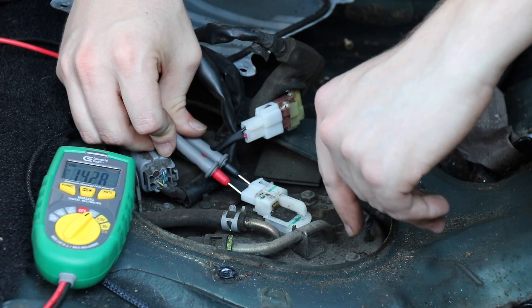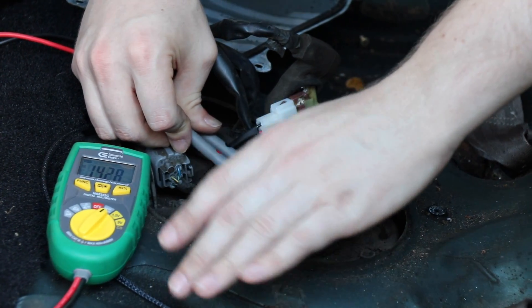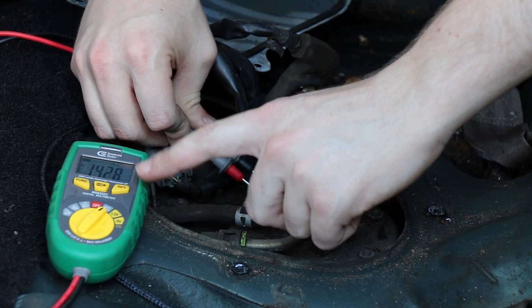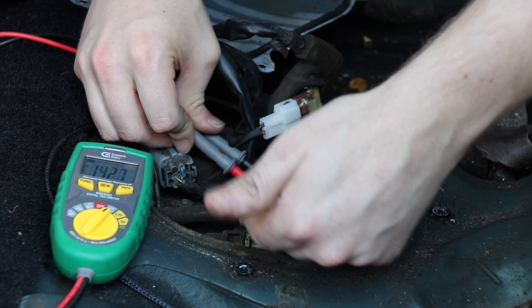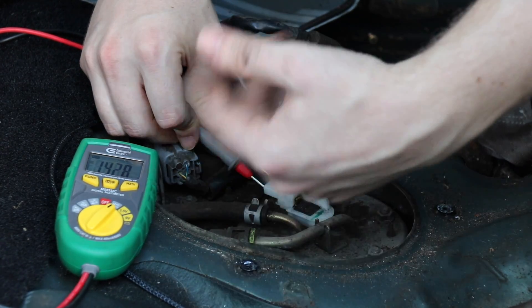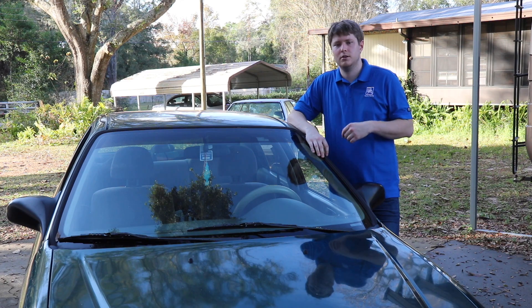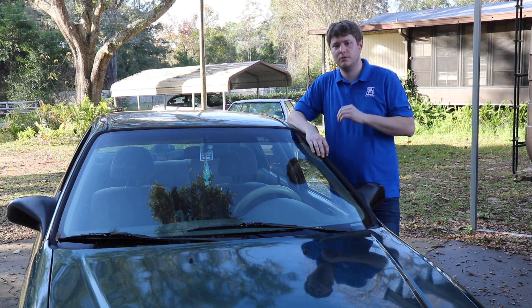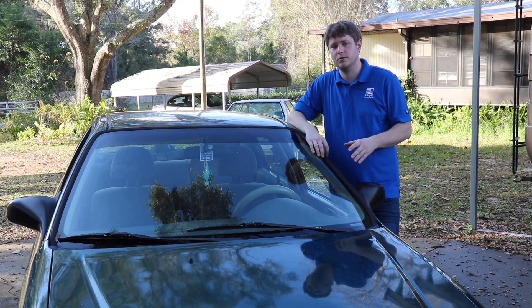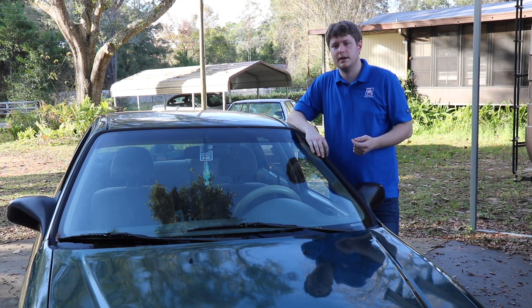Now with our complete system plugged in, instead of a regulated 12-volt signal to the fuel pump, we're actually getting 14.2 volts — bouncing between 14.25 and 14.28. So we now have a whole extra two volts going to our fuel pump, which is going to increase fuel flow by roughly 15% throughout the entire RPM range. You've seen just how easy it is to upgrade your fuel system's wiring and efficiently supply a 14-volt signal and increase fuel flow without any additional hardware. Just like every other Burton Racing product, it's easy and effective. You can find us at our website, Facebook, and Instagram, or inquire via the email in the description.